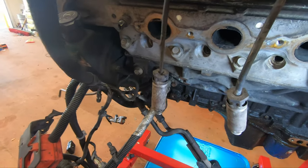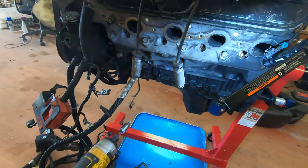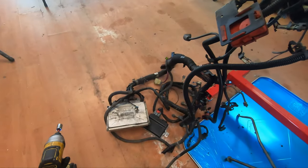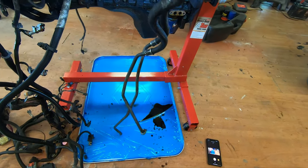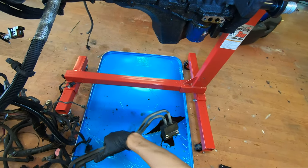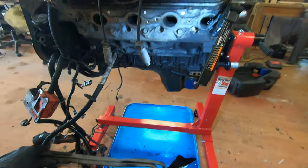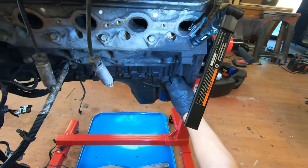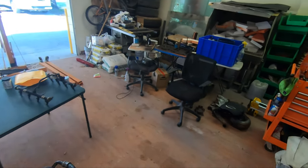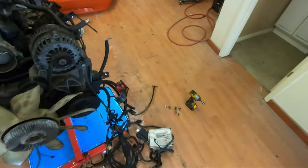Here we go. Okay, come on. Come on. Alright, I'm gonna just... Nah. A 13 mil. I don't think I'll lose it. Let me just double check that those are all kind of sort of empty. This is the oil cooler send and feed line. They make an adapter I'm gonna get. Basically, it adapts from this block to here for AN fitting, so I can run whatever kind of hell oil cooler I want.